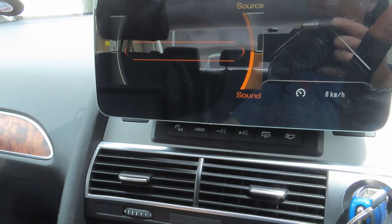Going back to the screen and putting it in park. I've got it set to no DVR because my DVR doesn't have a USB or RCA cable to connect to the system. There are a bunch of settings here. HD camera selection for the backup camera — I've got it on automatic and it picks up fine. There's also a front view mirror setting which flips the reverse camera image so it looks like you're looking toward the back of the car yourself.